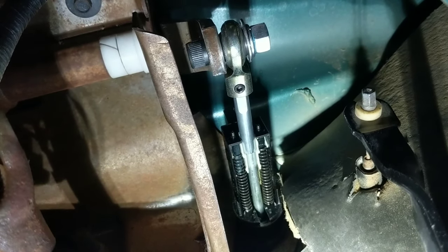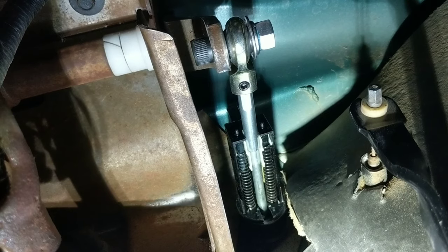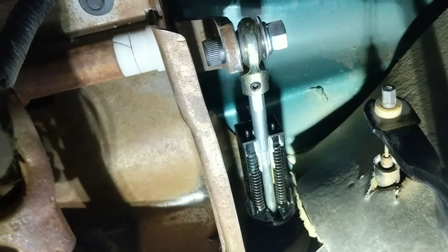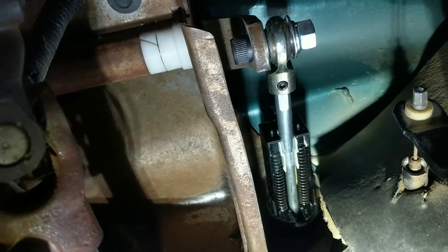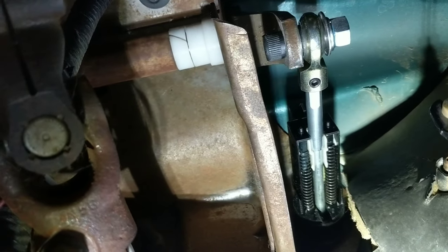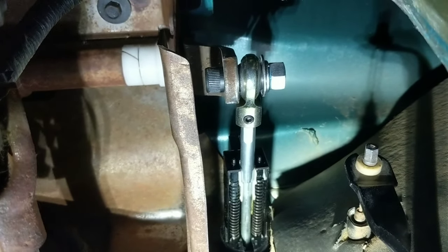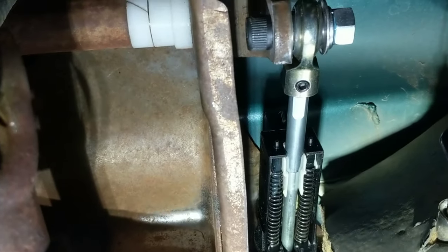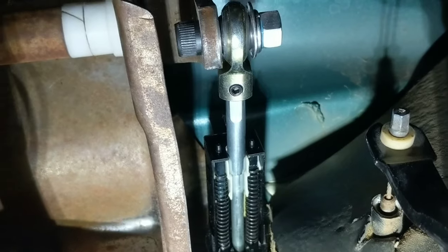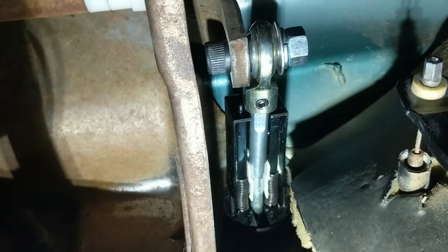Here is the final installation. The push rod is back inserted into the clutch master cylinder. The heim joint is installed on the end of the rod, loctited with the set screw — the set screw is also pointed down so I can tighten or loosen it if needed. It should not come loose. The heim joint is bolted to the swing arm and also loctited. You can see I have the cover off the neutral safety switch, which is on there — I don't have the wire harness plugged in yet, but I will.